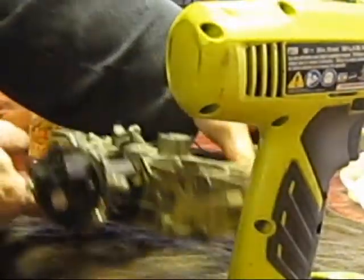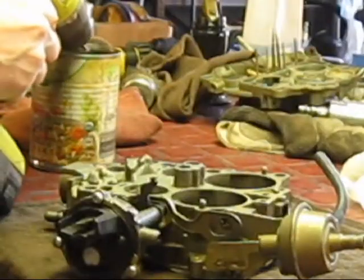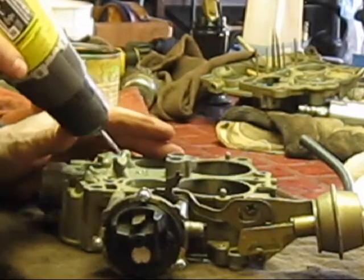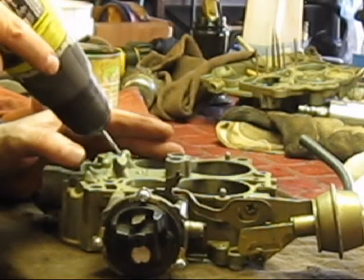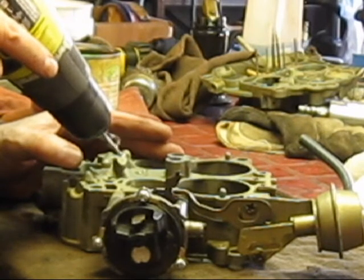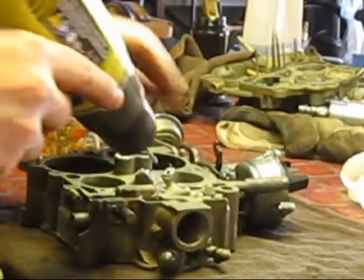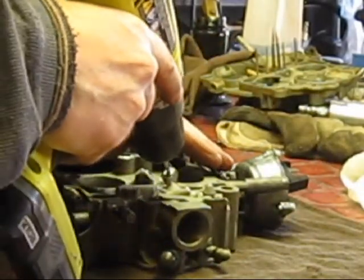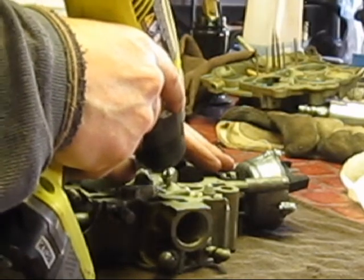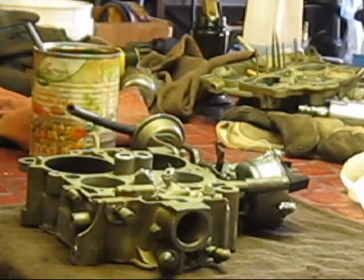Repeat the process. Just a little bit of lubricant. I don't really need it because it's such soft metal. I do recommend a 1/8 drill. That one went in pretty far — I'm not sure why this one didn't. There we go, that's nice.